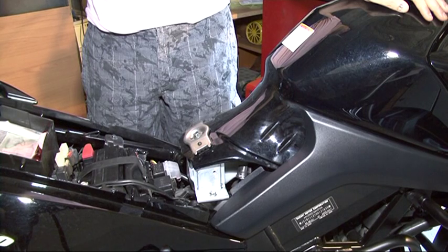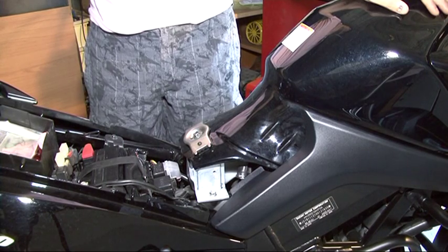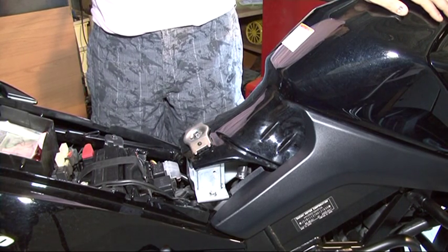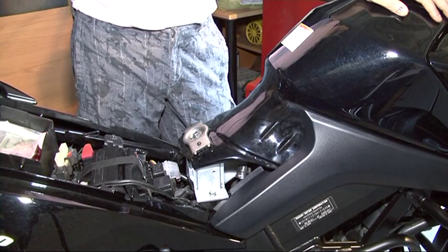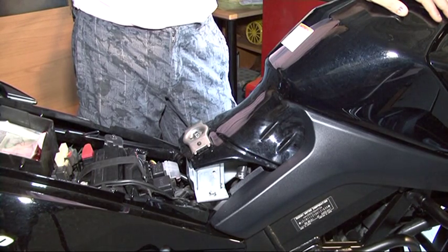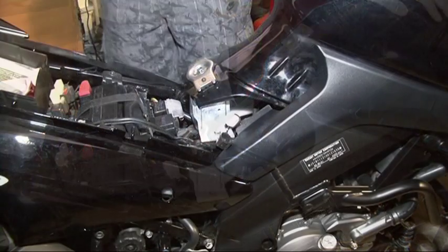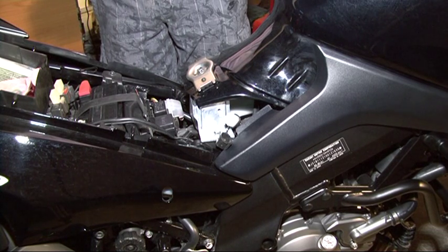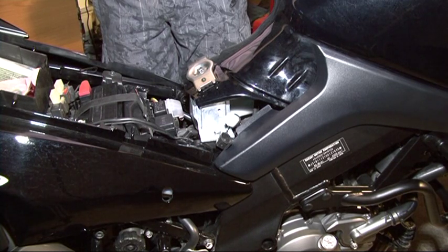The running mode of the bike is the normal mode where you ride and everything is fine, but there is also a dealer mode which is a diagnostic mode. If the bike has got some kind of problem, either electrical or with injection, it has the ability to inform the rider about the cause via the dealer mode. In user mode, if a fault indication error occurs, you will see the Fi letters displayed in the odometer readout area.